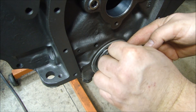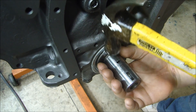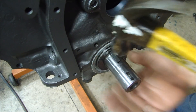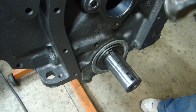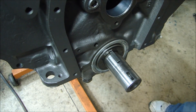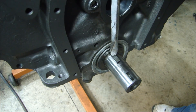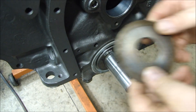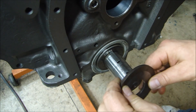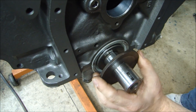So now I'm going to put my key in here, get it roughly about centered, and be careful. I'm going to tap this down with a hammer. Be careful not to hit that little shim there because that shim is stainless steel — it'll bend pretty easy. So I'm just going to tap that down lightly. And now I can take my thrust plate with the oil grooves facing the engine and put it on over the key.